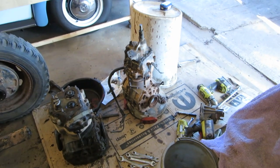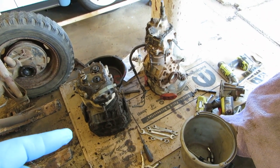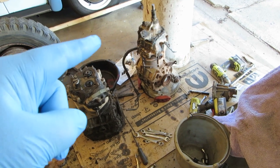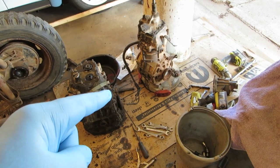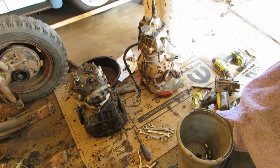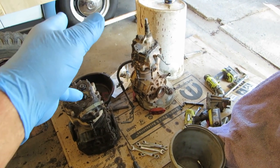The transmission goes through the gears, but does it slip out of gear? Will I need another transmission? I don't know. I'm just going to button that one up, clean it up, put a little sealant on the top of the cone, bolt it down, make sure it has fluid in it, change the mounts, and use the best mount. It doesn't make any sense to put a lot of money into something when you don't know it's going to work. Besides, it doesn't look like it's weeping out of the seals — and it's full of fluid.